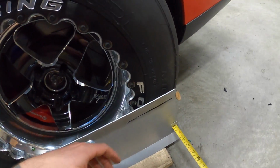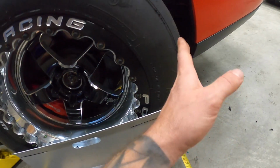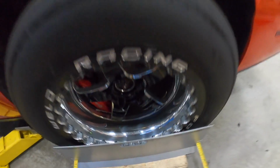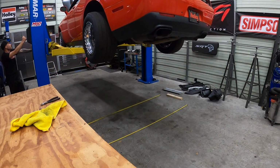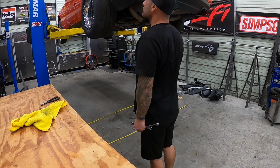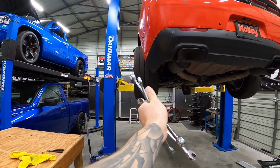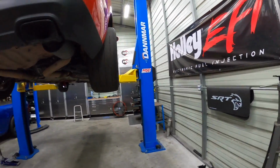So I'm gonna go ahead and take that adjuster and, like I said, suck the back of the wheel in, effectively kind of turn it like this, and then we should get a better measurement here. So let me try that. All right, so I just took that adjuster and just cranked it to push the toe of this wheel as far out as I can. Visually it looks a little bit better. Probably won't be able to tell from the camera.